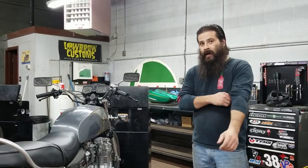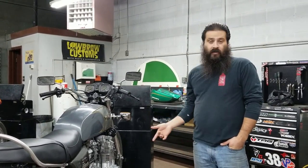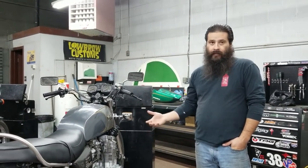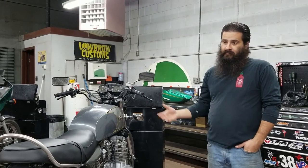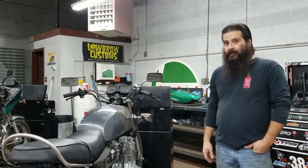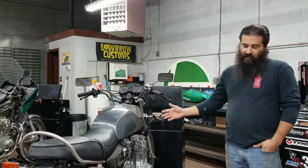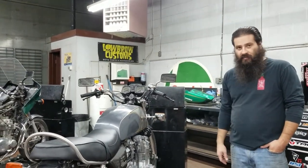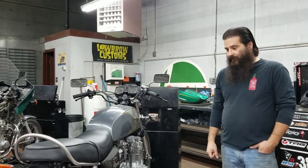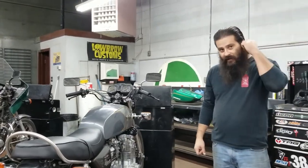Oh wow! Yeah. So we'll do the oil change first, and then we'll drain the fuel and add the Aspen fuel, and the customer wants spark plugs done, and that's pretty well it. Okay. That's all we really got to do. Winterize the bike. Cool. And check the tire pressures and maybe lube some cables and stuff like that. But that's pretty well it for a bike like this. So yeah, right on. Get started on that.